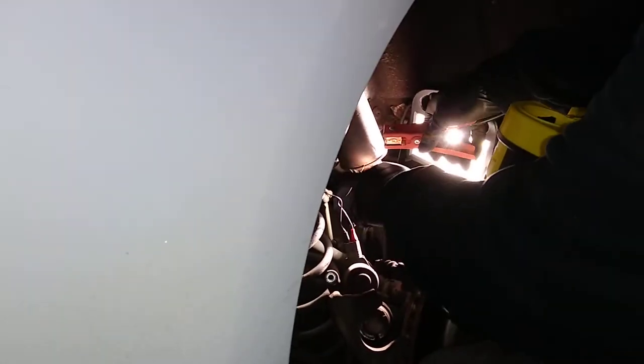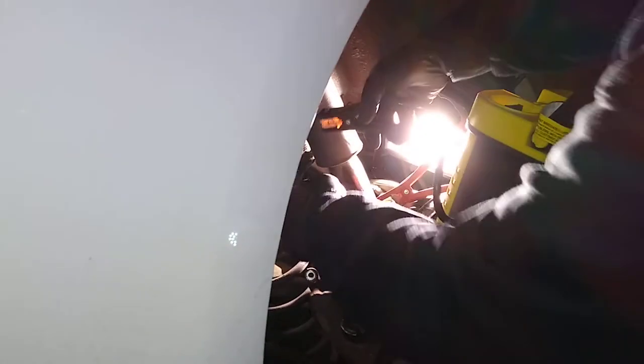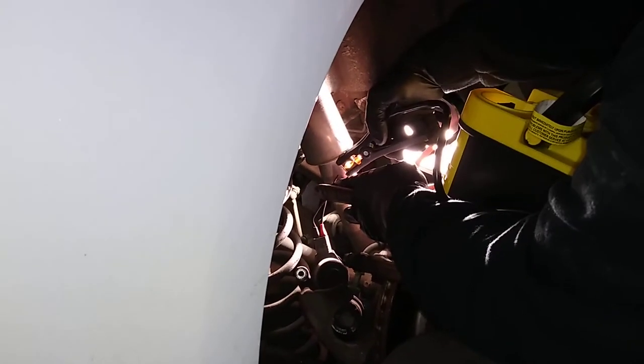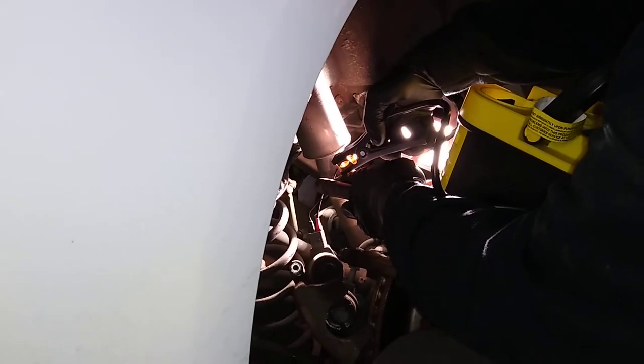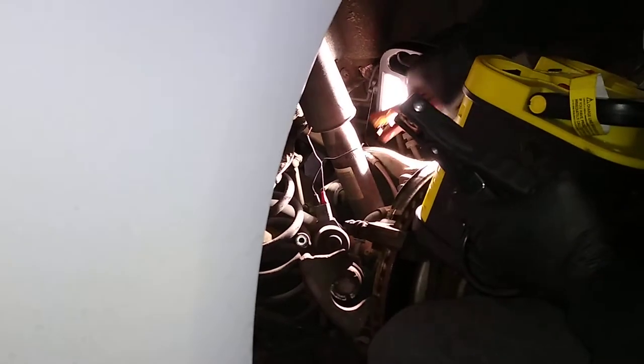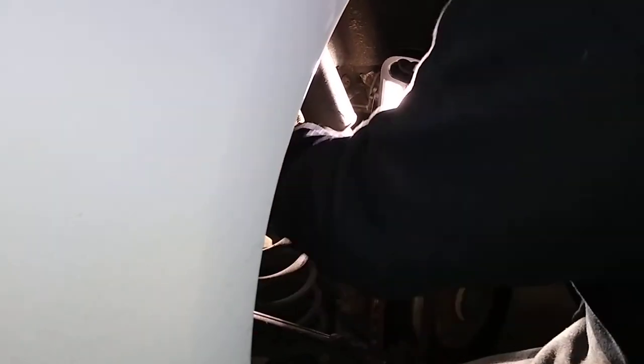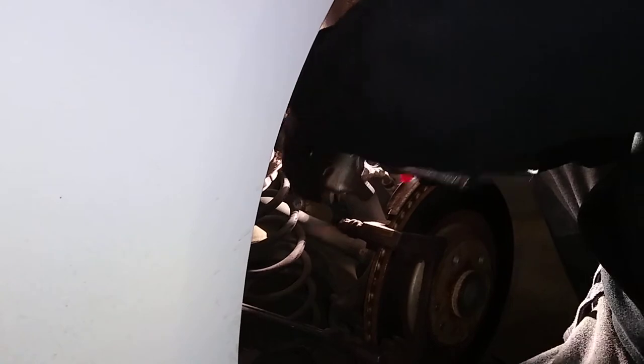I know when I first tried it I had little difficulties, and of course Audi was charging $900 just to redo the brakes. I don't currently have $900 to be doing that, but some people might. It takes a little bit to do it. When I first did it, I thought I was all the way in. It wasn't — it keeps winding in some more, and then you can hear it actually stop. I'm going to get it back in so that you guys can actually hear it when it stops, so that you won't burn your motor up by forcing it too much.